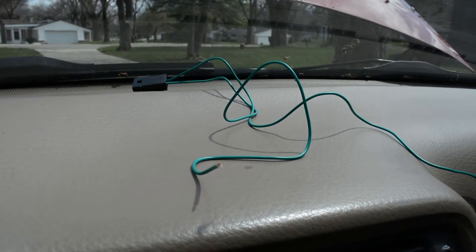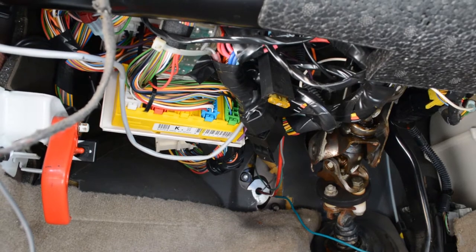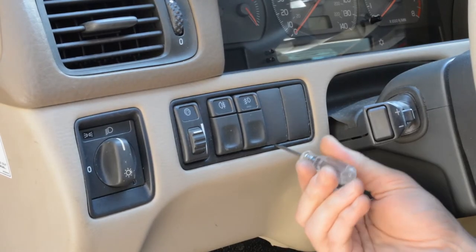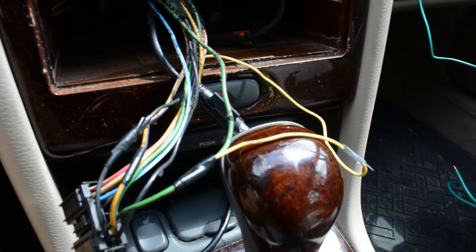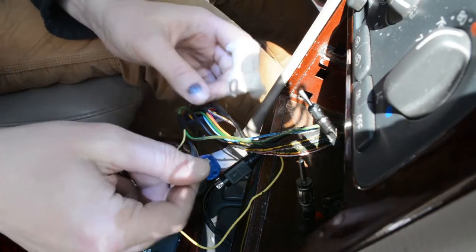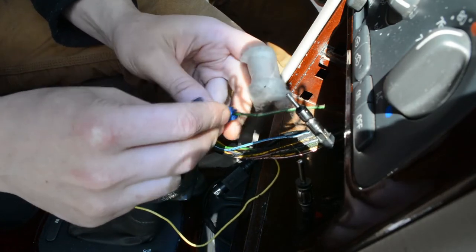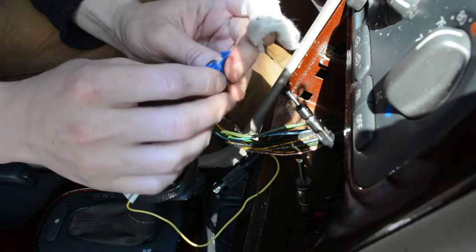This fused green wire is the 12-volt source for your switch. It can be a keyed or constant power source, whichever your preference. Try and pull your power source as close to where the switch will be mounted as possible. Since mine is going on the left side of the steering wheel in that switch bank I would pull from under the dash, but the previous owners installed a remote start system so I don't really know what's going on under there. Because of this I'm going to be pulling the 12-volt source from the radio — I wired in a Grom unit so I know that the power source is the green wire with the brown stripe on it.